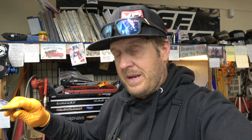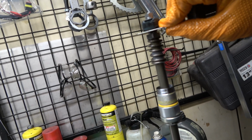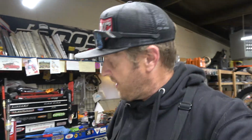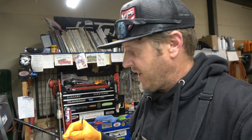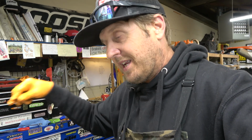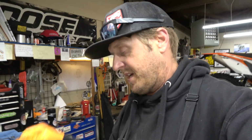But this is why, guys, we don't just sell shim stacks to people. There's lots of reasons. One is we make money, that's how we make a living. But also, a lot of it has to do with setting these heights, because when you put this all together, you need to tighten this down, and then come in here with your feeler gauge and check to make sure that your float is correct. That's the right fit, and I've got the spec for this. I already knew, because I did the other one, that the spec called for 3 of these little 10 by 30 real thick shims. They're clamp shims, not face shims, and they go inside that spring. They are for setting that height and setting that float. I already knew that 3 was too much, and the reason he specs 3 is because you want to check it, tighten it, and it turned out I needed 2. So that's one of those things: you don't just slam shims together and put it together. That's why we don't sell them.